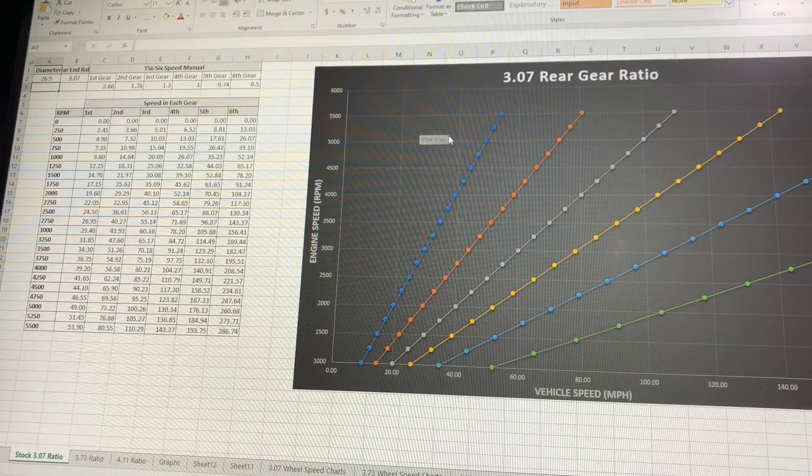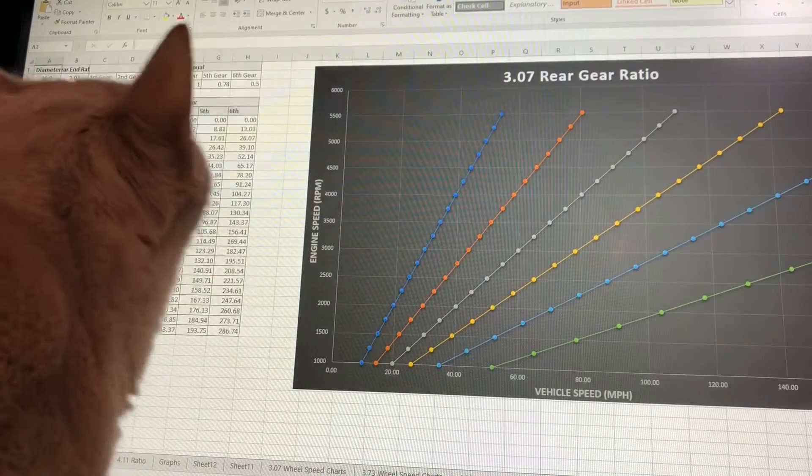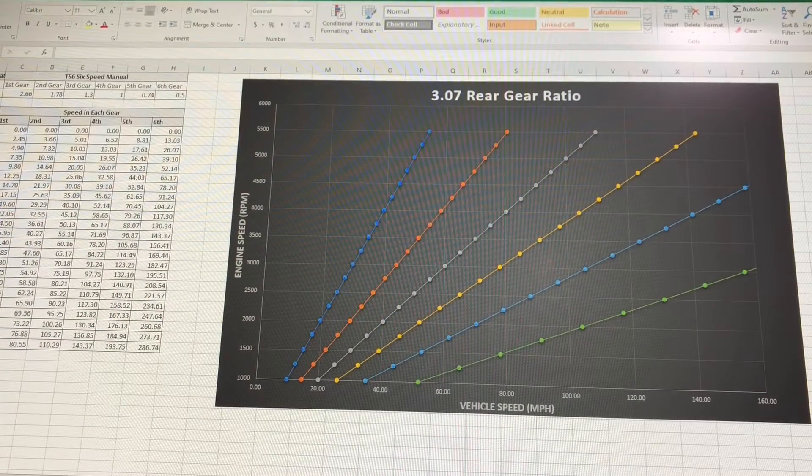All you need to know is your gear ratios, your tire height (which you can look up), and your rear end ratio. So I created a couple different tables for the stock 3.07s — what's in there right now. If we go back here and look at 3.07s, the takeaway is: if you know your tire diameter, your gear ratio, and your transmission gear ratios for each gear, we can look at cruising speed — when you're on the freeway at a constant speed in high gear.